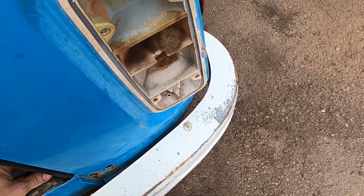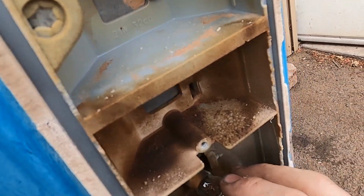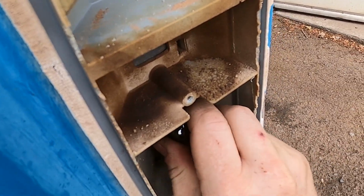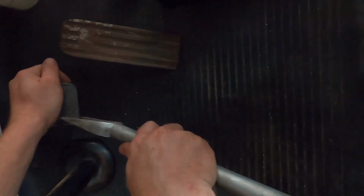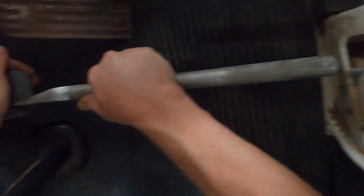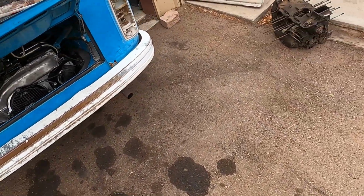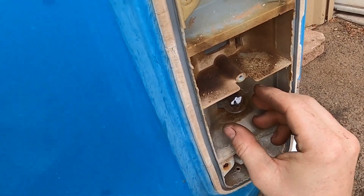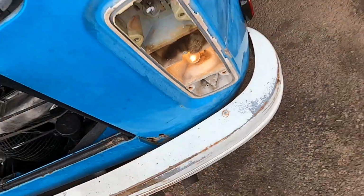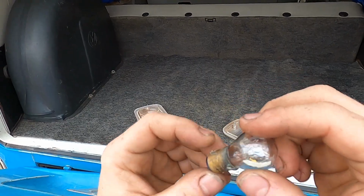So I'm gonna put this bulb back in, make sure it works as well. Yeah, that way, okay. That one is obviously working as well. Okay, so I'm gonna try and put the brake down as if they are engaged. Okay, and let's see if the brake's on. Brake is on, brake is not on. Now it switched. What the heck? Okay, it's lit up. I cleaned the contacts on that one as well, and the incorrect bulb was in there, so it doesn't have the offset pins, so I probably wasn't pushing back enough and connecting.